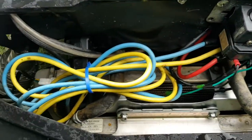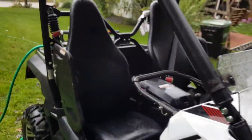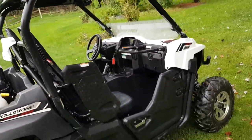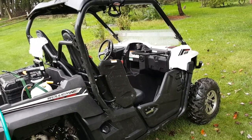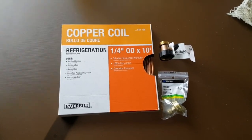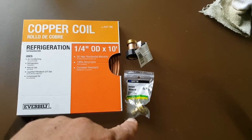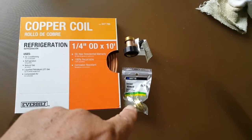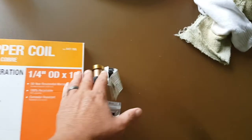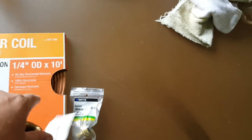It's back behind an oil cooler, so it's a little difficult to get down in there and give it a good cleaning. There is a product on the market you can buy from Amazon for somewhere between 30 and 40 bucks, but I decided today I'm going to build my own. Here's what we're going to use: 10 feet of copper coil, quarter inch. I could have gone three-eighths but I'm cheap. We have a compression fitting adapter on one side for the quarter inch and a hose adapter on the other, plus a brass shutoff so I can control the flow without running back and forth to the spigot, and switch back over to the hose whenever needed.